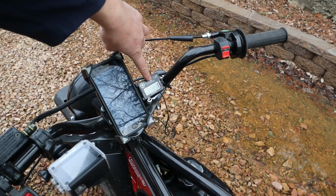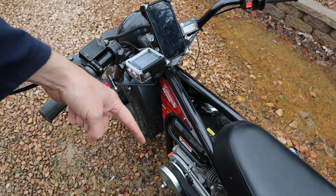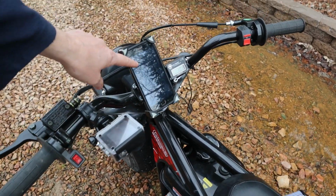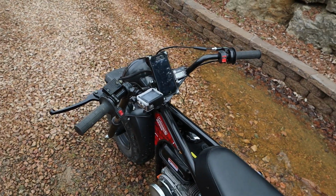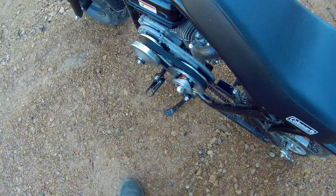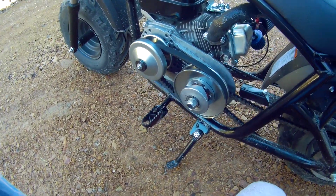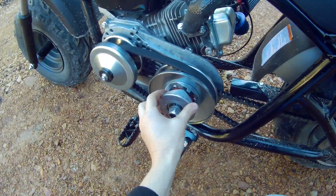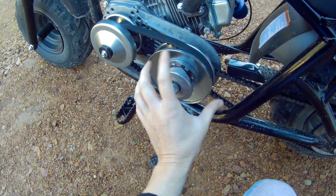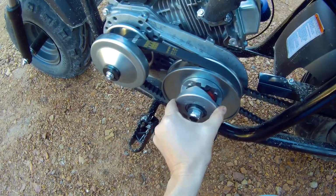We have our tachometer here. We're going to show where the pulley opens up to by having this camera placement pointed down at the pulleys while we engage, and checking out our top speed as well in case we get an increase in top speed as we move that spring position. Let's get to it. Okay, now I've actually already finished filming a couple days ago every spring color in every single position, and because I had interesting results, I am just going to reshoot them really quick and show you the highlights.